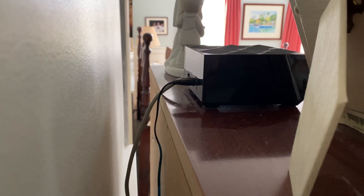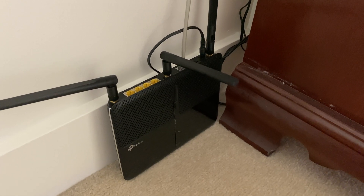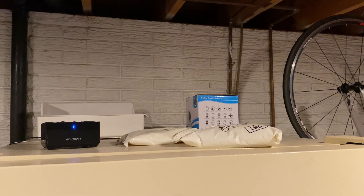I found one solution that actually worked. Essentially, take your old router, or go out and buy just an extender — another router you can plug in as an additional access point to one of the access points in your mesh network. For me, I have one downstairs, one upstairs in a bedroom, and one in the basement. The bedroom one is ideal because the network signal travels down better than it goes up, so use the highest and most centrally located router in your house.